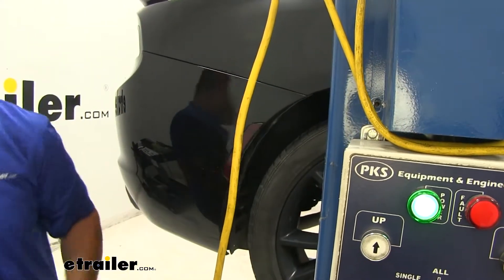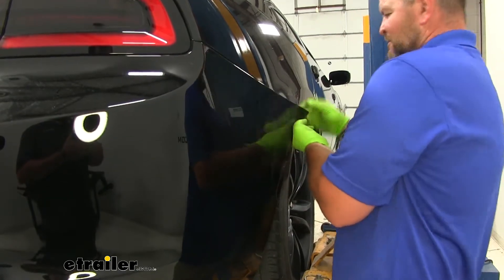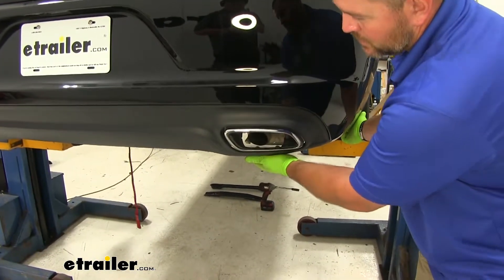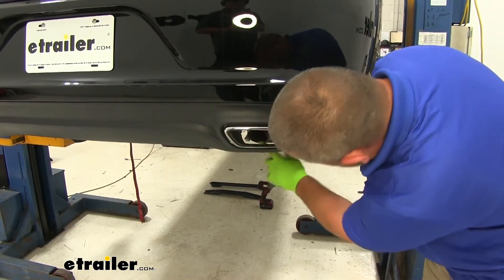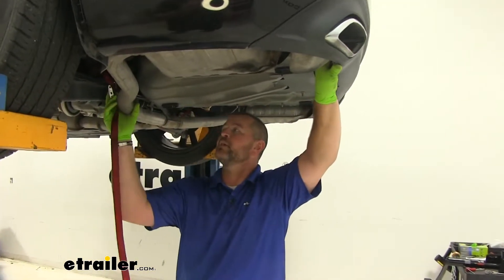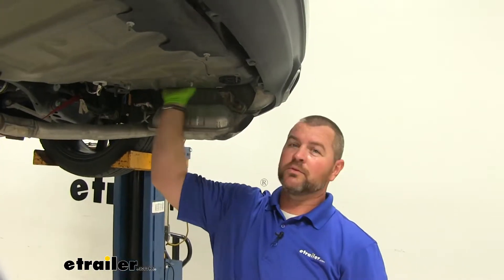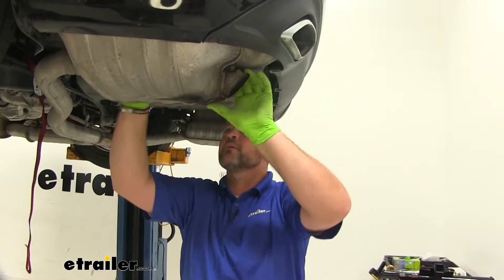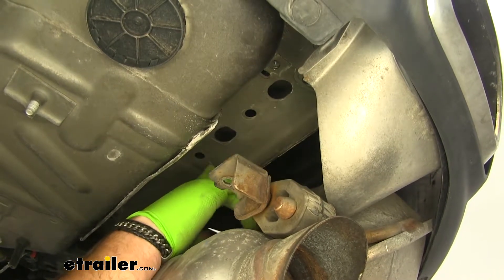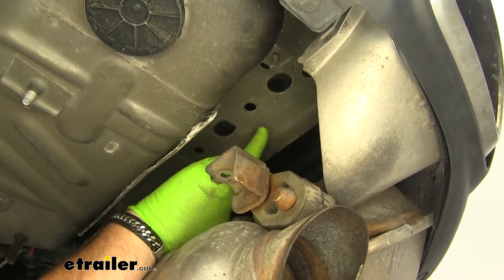You're going to do this on each side of the vehicle. Then right here at the edge of our fascia, we're going to slowly pull it out — just like that. That gives us enough room, enough flex at the bottom of our bumper to get our pipe past the tip on the inside. Now we're going to flex out the bottom and take a little bit of tension off of our strap. We need to be able to get up and access these holes. We're going to be using these two holes on both sides of the vehicle. On our passenger side we're going to pull a bolt down through both of these. On the driver side we're going to pull a bolt down through the front one, and the other one is actually going to be threaded — we're going to thread a bolt up into it.